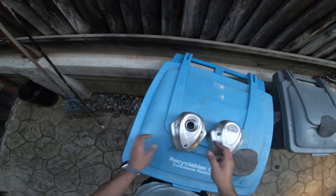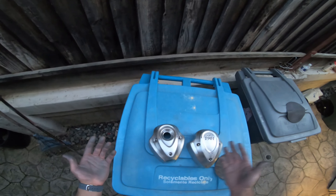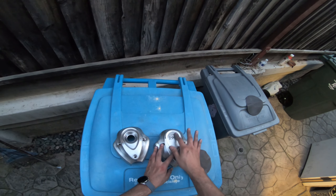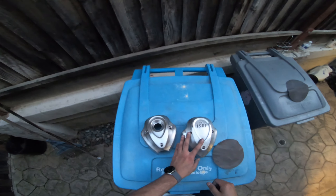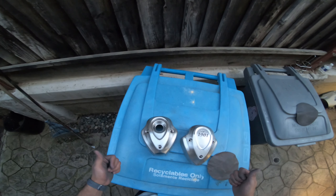The only potential issue is these areas where the bolts will go inside — that's gonna be a little bit difficult to sand down, but maybe I'll spend a little bit of time trying to get that, and hopefully the self-etching primer will also help take care of that issue. I'm also gonna go ahead and spray paint the screws as well, so everything is gonna be black. The only thing that should be chrome after all of this is hopefully the little inlay here. See y'all tomorrow where we're gonna go ahead and get this ready for painting.